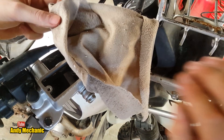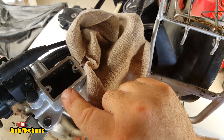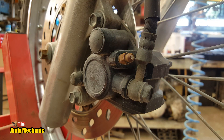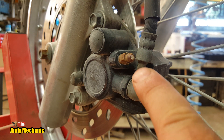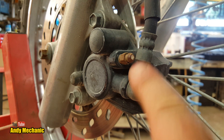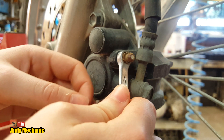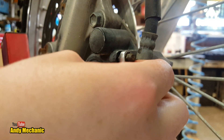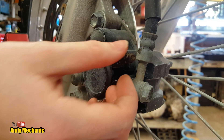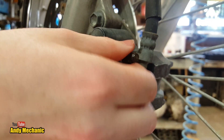I'm going to keep topping that up and you're going to use the tool. Next job Holly — crack off and remove the bleed nipple. The reason we're removing it is it looks like it's full of crud in the end, so we're going to clean that out. Do you want some gloves for this? Okay, start at the top, push it down, lose your spanner, come in from this side — there you go!